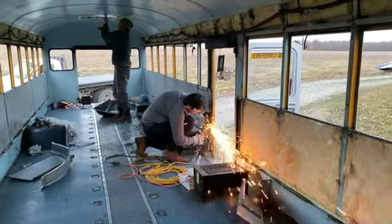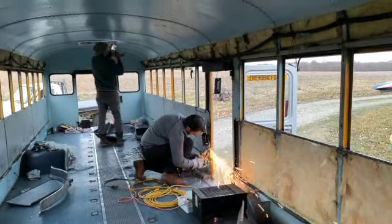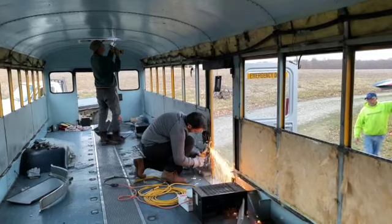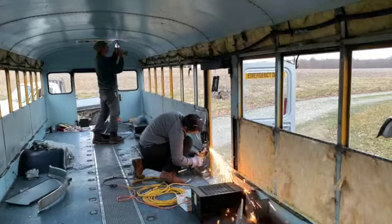Another thing you just brought to my mind is the curvature of the bus. It's not one set height throughout the whole bus. It's actually a curve. So even though we raised it 6 inches, the edge of the bus is still just 7 foot high. After we add the ceiling and everything, it's probably going to be even shorter on that side. Those people who are cooking and are like this, I don't want to be those people. So what materials did we need?